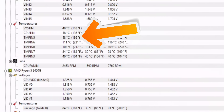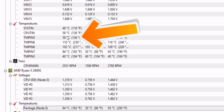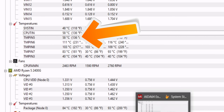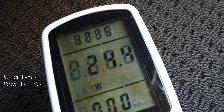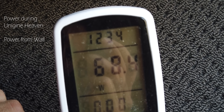In terms of VRM temperatures and APU temperatures with this cooler on - it just managed to fit as mentioned - the temperatures were well controlled. We got the node temperatures up to 93 degrees in a 26-degree ambient environment, and the CPU went up to 58 degrees from the TIN sensor. The thermal imaging camera showed the ventilation with the mesh side and front was allowing the unit to breathe, using about 85 watts in AIDA64 on the stress test, 25 watts idle roughly, and around 70 watts during the Heaven benchmark.